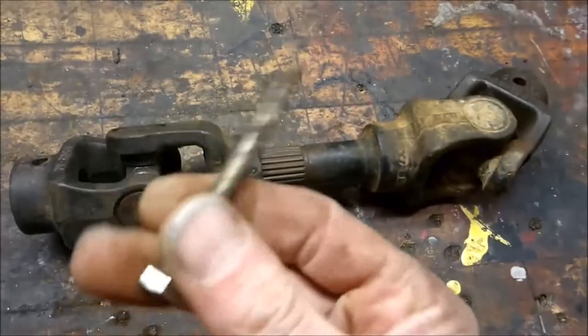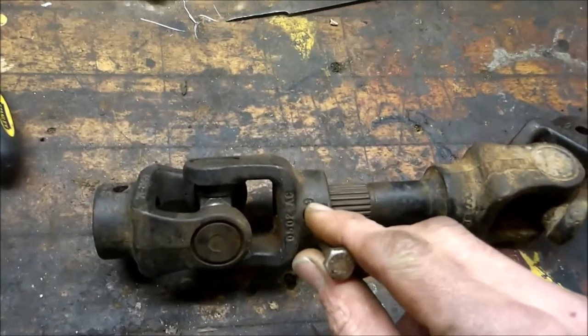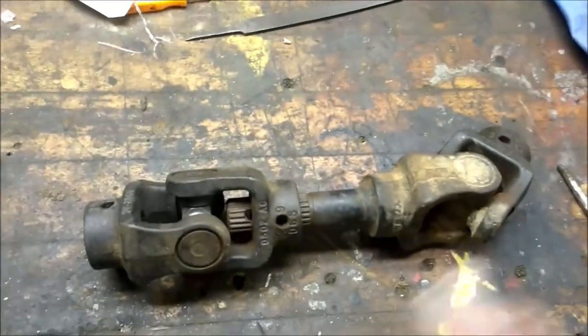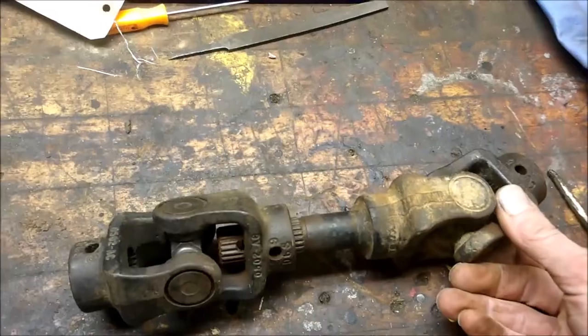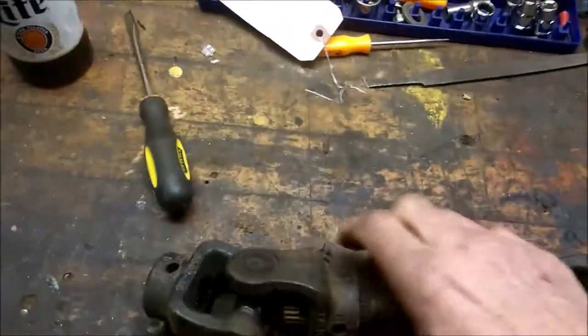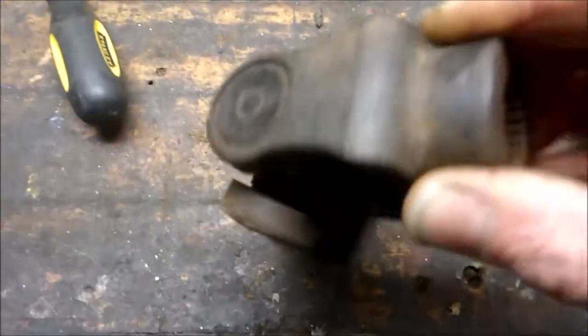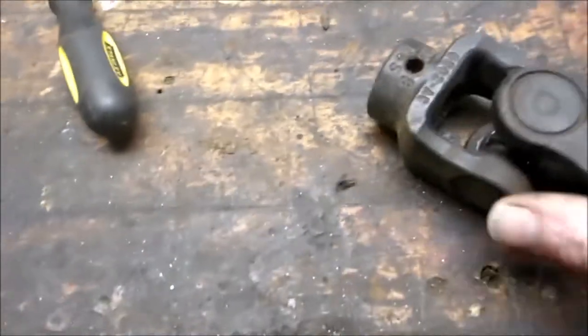Bring this up to the bench, I'll show you what I did. In 2002, this slides in and out. So when you remove that pin, what I did was I made my own punch — you can buy a punch. You punch out that pin, punch it all the way through, and then this slides back away from the differential, and then you can pull this out from the transmission and it comes out. So if you look at this, this is horrible. I guess they're known for that from the research I've done. This is all pretty chewed up. This is shot.